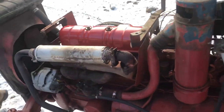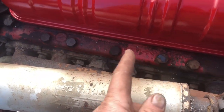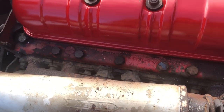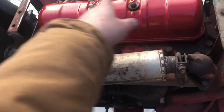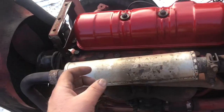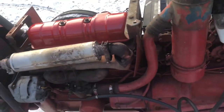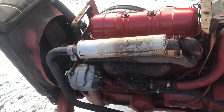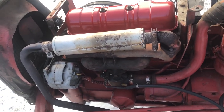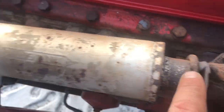Let's fire it up — I can really hear it coming from about here. I don't know if it's got a bad wrist pin in there or something. What we're eventually going to do is take all this off again, take out the valve train, all the lifter rods and stuff, then pull the head off and have a look at the pistons and everything in there and see what's going on. The head gasket is probably fine, but I'll have to get a kit for it. This could be something simple like an exhaust leak — I can see a little bit right there.